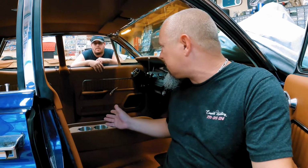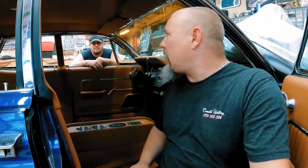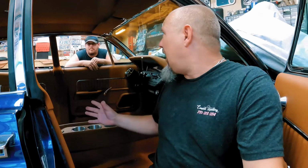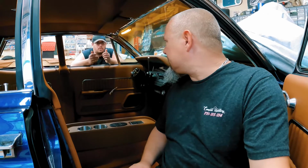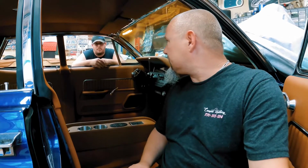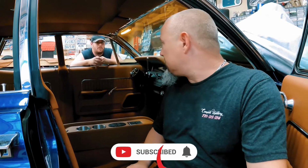And the door handles, I remember you saying that the door handles were made out of fiberglass? Yeah, the armrests are MDF based to start with, and then the contoured section on the back of them is all fiberglass. Okay, very nice. And I see that there used to be a bow headliner in this vehicle, but this one is definitely a one piece. It's got a nice little sew line around it. How did you do that? Basically, I just put a wood perimeter up, mounted to the metal structure of the car. And it's just a piece of the water-resistant panel board with the material glued and sewn and screwed to that wood structure and floated to the sides.